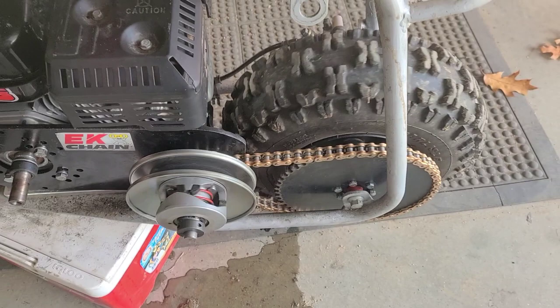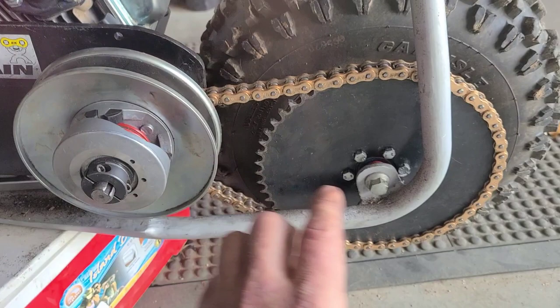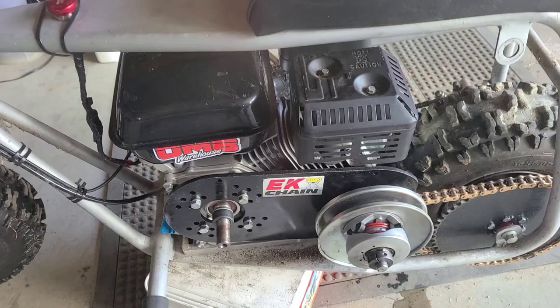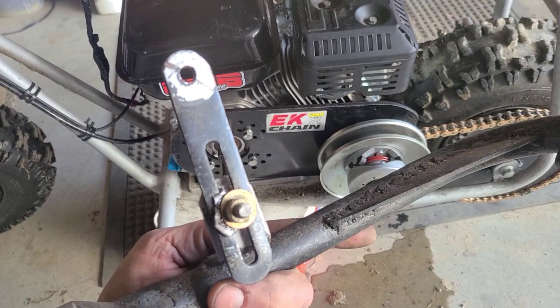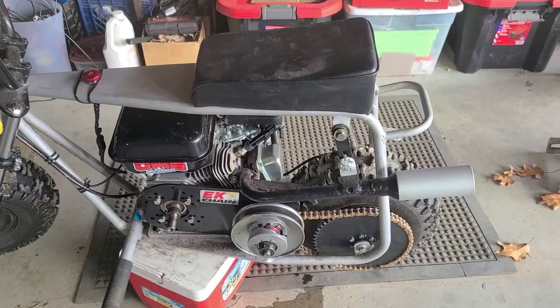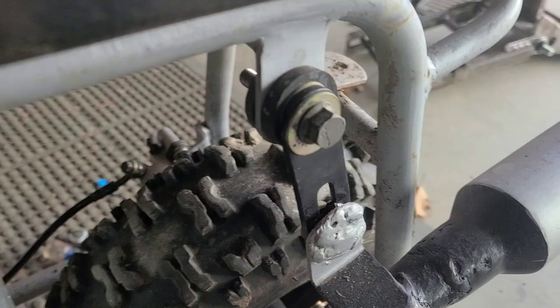Just like butter. The custom mount on this frame, paired with this torque converter plate, allow us to run an extremely short chain. We can leave it a little bit loose, and it's not going to go anywhere. This mini bike also has the option of using its own exhaust system. It's one piece in design with an adjustable hanger. It can go up, down, forwards and back. There's the hardware to mount it. There's the exhaust installed. And I even included these rubber inserts to help reduce vibration.